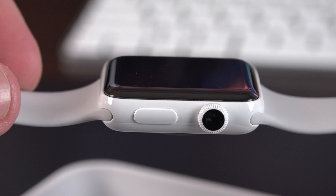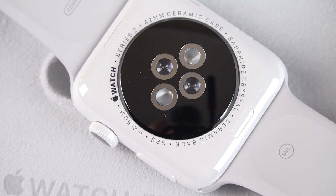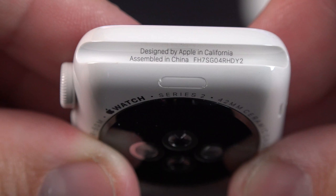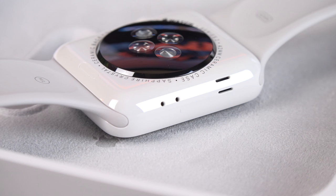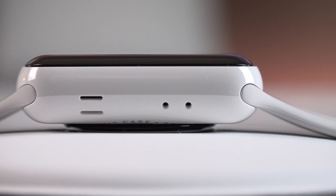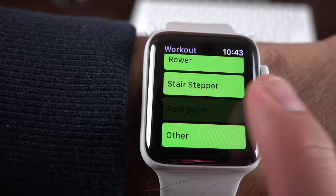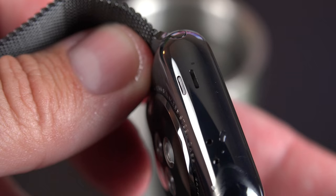The sapphire crystal has a nice reflection that looks a little more jewel-like than plain glass. The text on the back reflects the new features such as the GPS antenna, waterproofing up to 50 meters, and Series 2. The serial number and model number are hidden within the watch band slot, so you'll see them if you remove the bands. Along the side, you'll see two portholes — one is a microphone and one is an air vent. There's also a new speaker design engineered to eject water when wet. If you enable one of the swimming modes, the screen locks because it won't operate underwater. To exit, you use the digital crown or the side buttons, which ejects water from the speaker by emitting a specific tone.